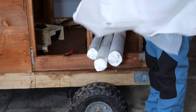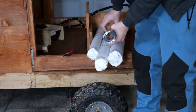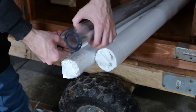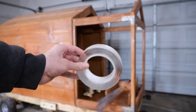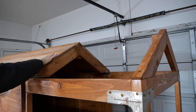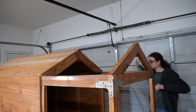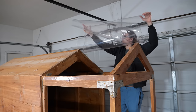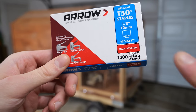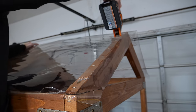That's exactly what I have in these rolls. You're probably thinking — what kind of windows come in rolls? Well, these are some rolls of clear vinyl, sold as like table protectors. They're like one and a half millimeters thick, and I think they're going to make perfect windows for this little camper. The first step to installing these is going to involve some stuff called alien tape — it's like a thick cushioned double-sided tape that has a nice grip to it — and I'm going to put it up against wherever the vinyl is going to butt up against the wood. Then I can gently take the vinyl sheet, place it precisely in the middle, and roll it over the edges of the alien tape. I can then take a staple gun and some stainless steel staples and begin to staple the vinyl through the alien tape to the wood all around all of the edges.